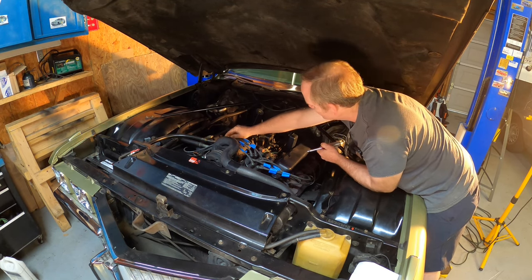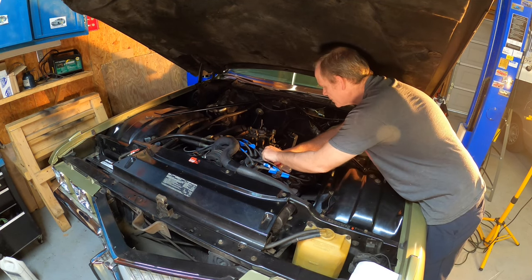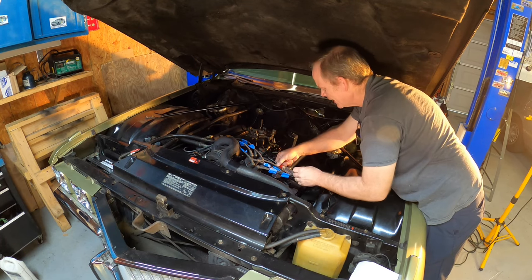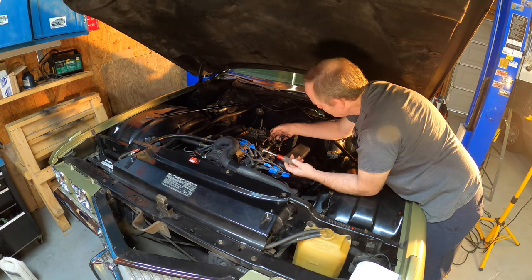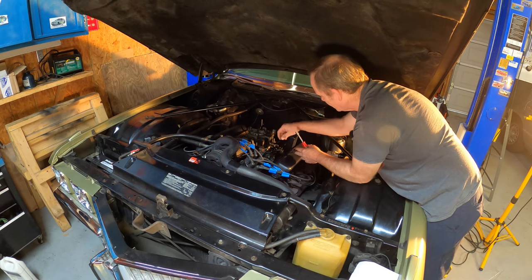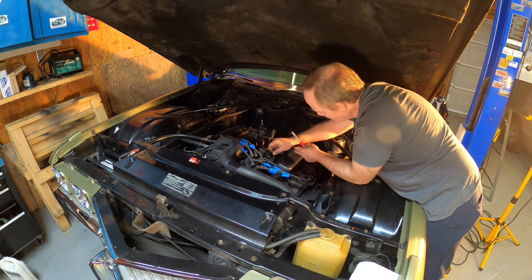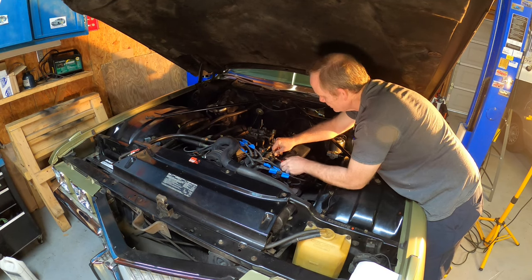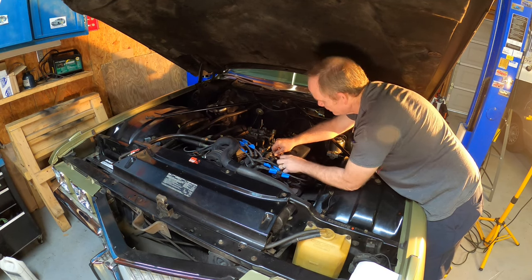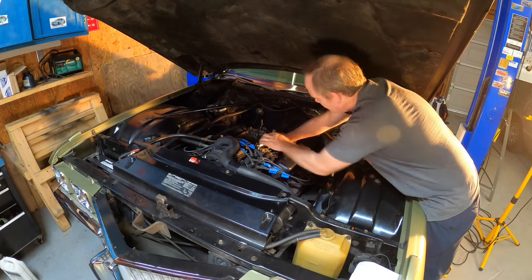This little guy goes over to the compressor, and we'll disconnect the negative side going to the distributor — it's 11/32nds, not sure why. Here's our power coming in. With this being a modern electronic system, the resistor wire will be eliminated from this setup — I'll show you how we're going to do that. We're going to retain the stock mounting stuff to look original.